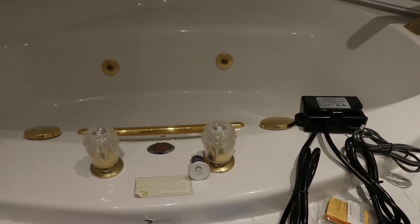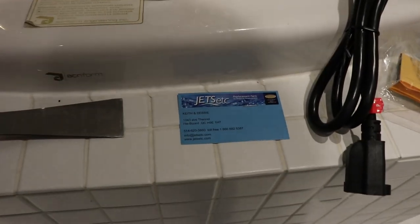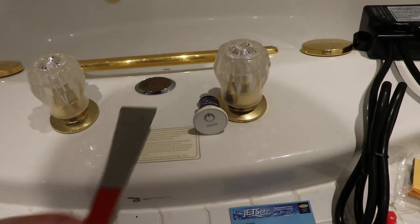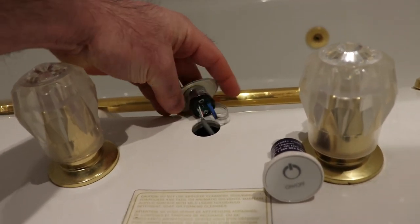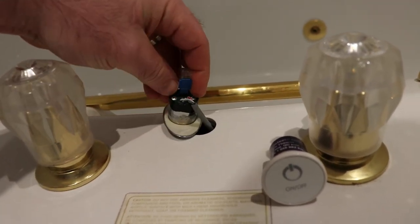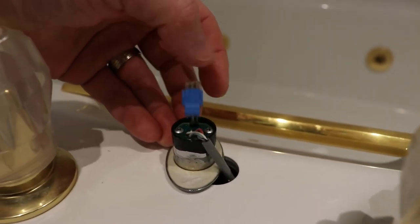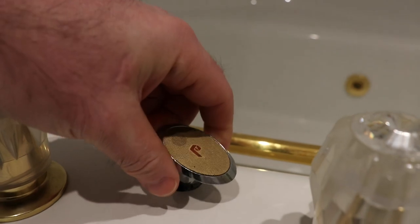So I tried to do some troubleshooting. I went to Jets etc's website and they gave some instructions on how to work on these tubs. Basically you can just take a glazier's bar and if you work it around here enough you can break the bond for this controller. It's just kind of glued down to the tub. You'll look in here and what they tell you to do is pull off this blue connector and then take a screwdriver and short out these two pins here, and the tub should start. If it doesn't start, then you know it's a bigger problem than just this button.